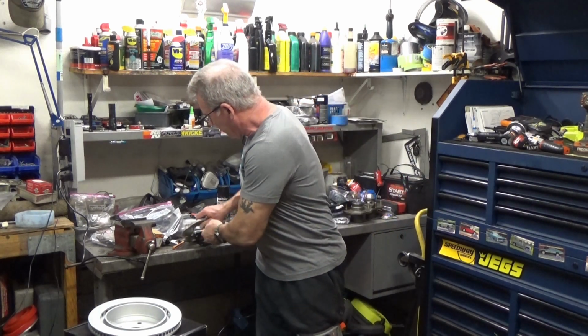So now again, that is for a Chevrolet rear end. I have a '69 GTO 390 Posi in here. What is that rear end? That's a BOP rear end, right? Pontiac, Oldsmobile, Buick. And what's different about that rear end? It's bolt-in axles. Yeah. No C-clip.